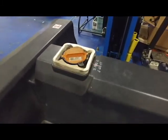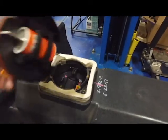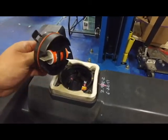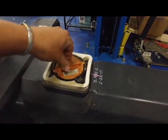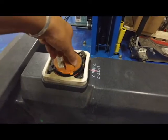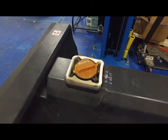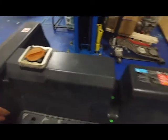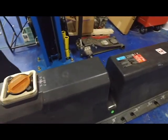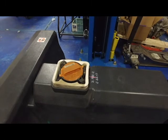I should point out that this guy here on top is the OEM from the Volt — it's like a fuse. It says 420 volt DC. It only makes contact when it's in like this and pushed down, and then you can pull this out and twist it to keep it from making contact. So when that's not connected, there's no voltage going through the front because this battery is all in series and this breaks the series halfway through. You'll see more once we take it apart.